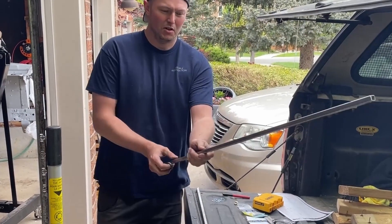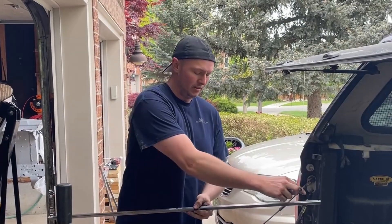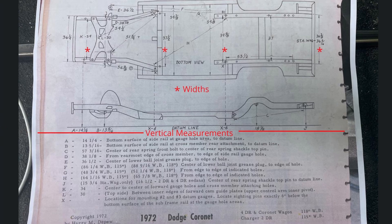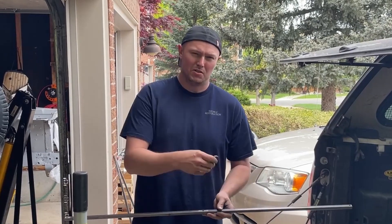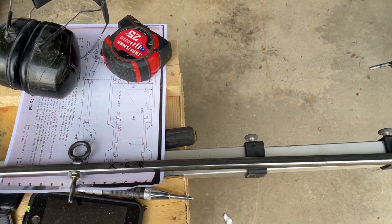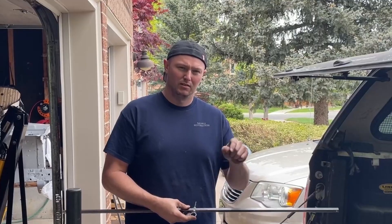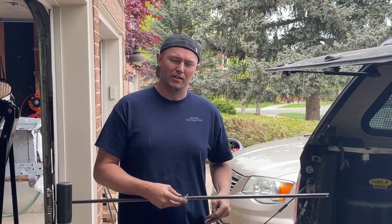This is our bar for our datum centerline gauge. We've drilled holes in it in accordance with our frame diagram and dimensions. What we're going to do is take an eyelet, drill our center hole, and make sure it's exactly centered between our two measurements as per the drawing. When it's all assembled and we have the gauges hanging off the bottom of the car, these eyelets should all line up — you should be able to see one eyelet or all the eyelets perfectly aligned. If they're offset, that means the gauges aren't aligned.